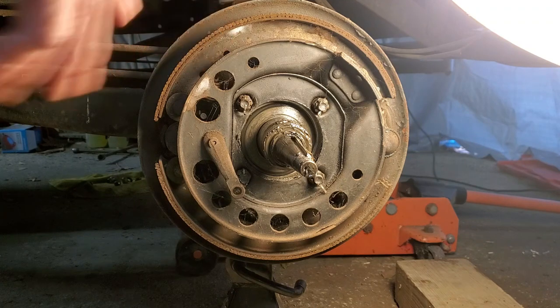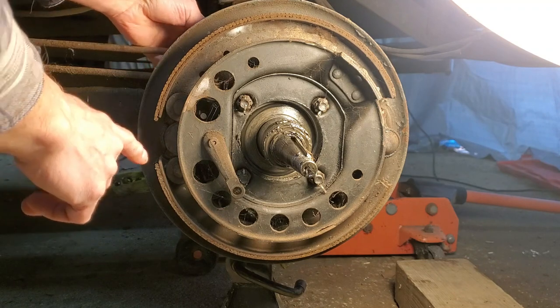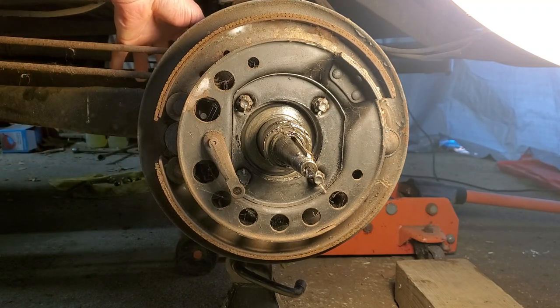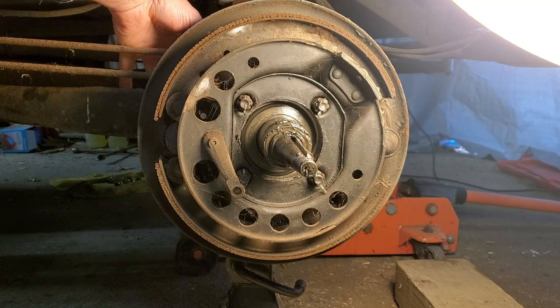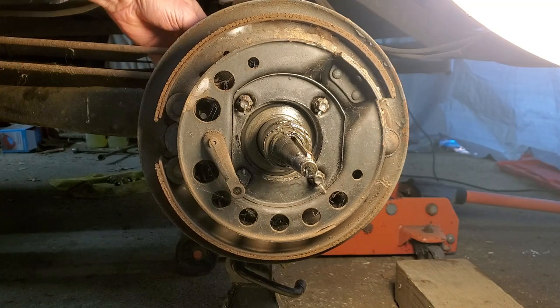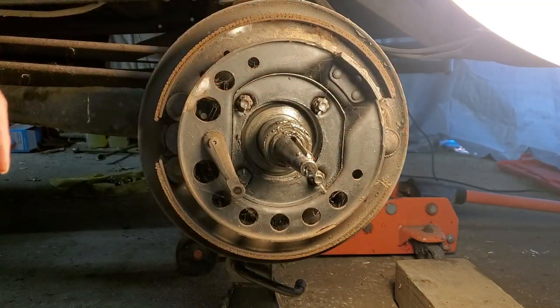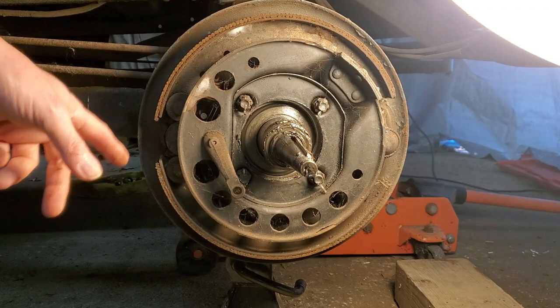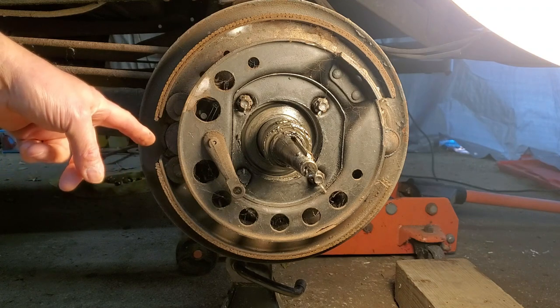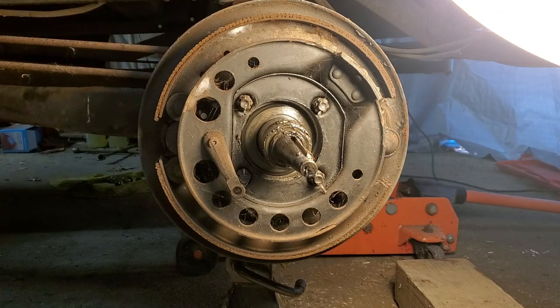They look like they're going to be all right so far, except for naturally the bushing. When I did the grease job, that was the one grease fitting that still had the original one on it. So it probably hasn't been greased in 50 years, and it's got some wear on it. So I'm going to pull these off, order the whole emergency brake kit. It looks like it comes with everything you need. And I'm going to do the bushings on the service brake and the e-brake while I got it off. That way this whole back brake system will be done.